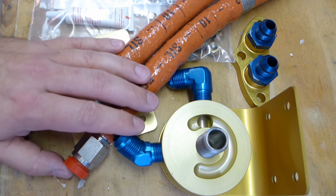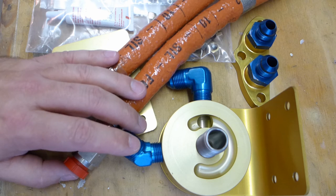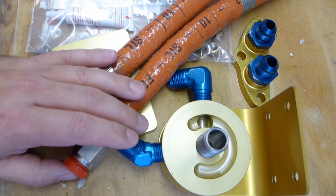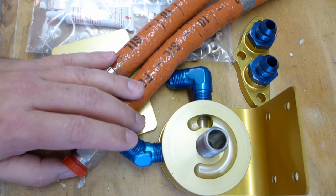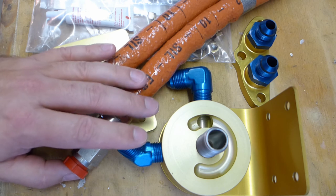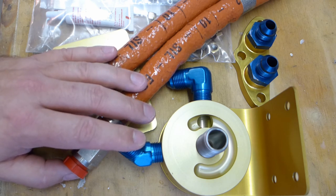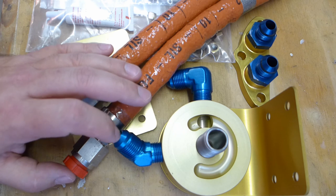I'm gonna put in strobe lights on the wingtips, which is a requirement for night flight — you need anti-collision lights. And I don't remember what else, but several nice things. A new intercom, because the intercom that came with the plane is portable and it's falling apart — it's a piece of crap at this point. At one point it was okay, but this will be much more convenient. I'll have headphone jacks in the panel, so the wiring situation will be much nicer. I won't have wires dangling all over from the headsets going in front of the trim control, which has been just one more distraction as I'm trying to learn how to fly.